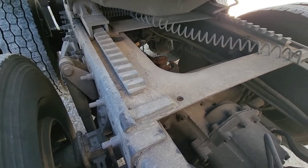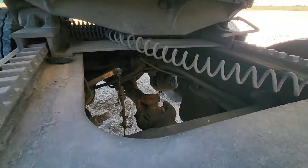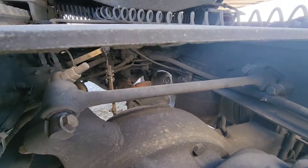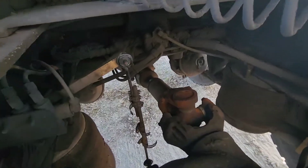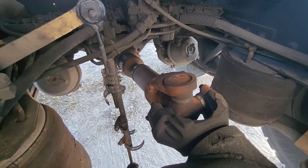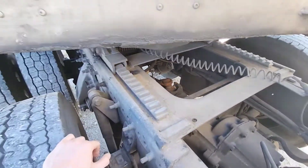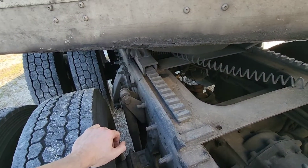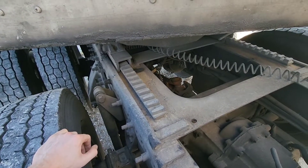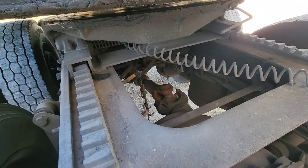If it's still vibrating, the next thing to look at is your driveline. My airbags are dropped right now and the drive shaft going from this axle to that axle is actually angled — it's dropping pretty far down in the back, so there's a steep angle on these u-joints. If I was going 65 miles an hour with the airbags dropped at that angle, I'd feel all sorts of vibrations coming from the back, and it would be chewing up my u-joints.